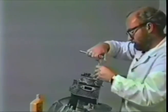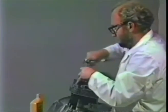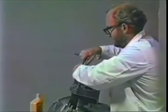Torque, well, don't torque, just snug down the nuts. Not even tight. Take a couple of passes to do this. You want to creep up on bringing the head into contact with the cylinders so everything is done kind of smoothly and easily. You don't want to just lean on one particular nut to get it all down. You want to bring everything down evenly and happily, like a nice landing on an airplane. You don't want to hit the ground hard. You want to come in for a nice smooth landing.